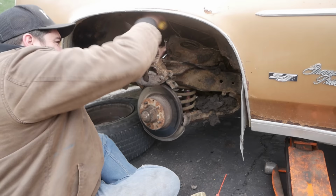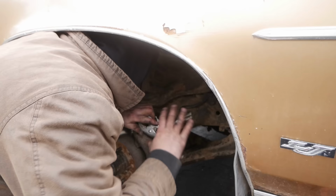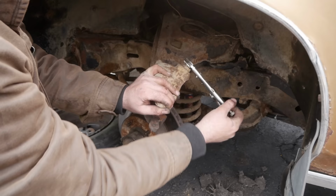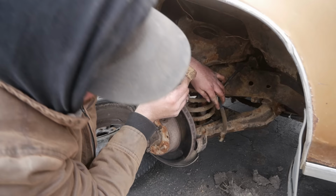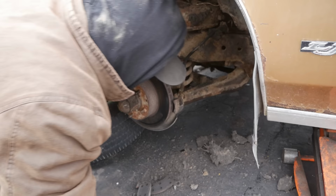That's a good point. I am the impact. And I stripped it. I've resorted to the vice grips. Yeah. I hate this. We also put our jack stands underneath this for safety. Success. Victorious. Let's see if there's fluid in here. That'll tell us if that hose is... Nope. That really ought to be coming out of there, I would think. Caliper's full. It's got a couple drips, but that kind of makes me feel like it's a hose more than... We could try to go for it.